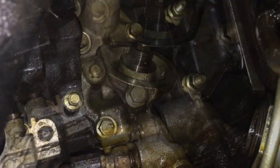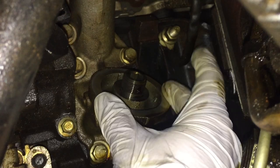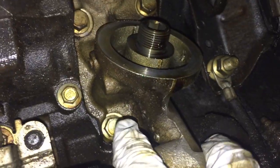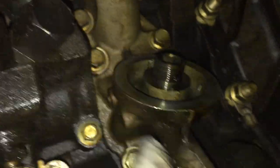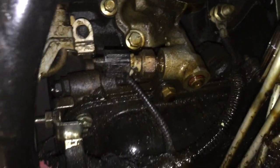Here's our oil filter adapter — this is where the oil filter goes on. We're going to remove its housing. There are just four bolts — one, two, three, four — they're 13 millimeter. The fun part is that when this comes off, you have coolant coming through here for the oil cooler, so you will have a lot of coolant come out. Make sure you still have your bucket handy.